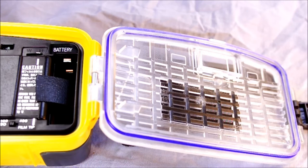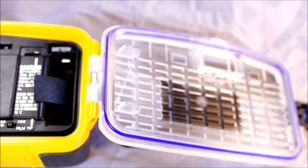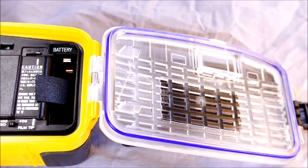For the blue O-rings, apply the blue cap sealant — it has a blue cap on it — which helps the O-rings stay pliable and elastic and survive longer. After using the camera, especially in the ocean or at the beach, rinse the camera body in tap water, keeping it sealed the whole time so water doesn't get in. After it's dry and you're swapping out the black O-ring for the blue, rinse the O-rings in water to remove any dirt. The camera can also be soaked for up to a full day if dirt and salt are particularly stubborn — just close it, seal it, and let it soak in water for a day.